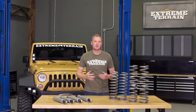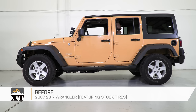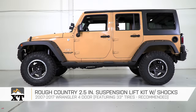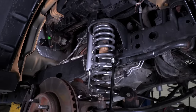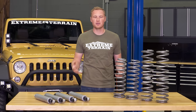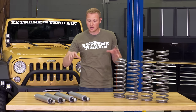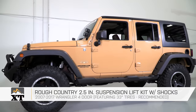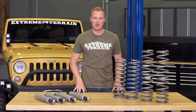If you're looking to run 33-inch tires and you'd like 2.5 inches of lift, I'd recommend taking a look at this Rough Country 2.5-inch lift kit with shocks for an economical solution. This kit includes your taller coil springs, your shocks, and also some brake line extension brackets, but not a lot of the other bells and whistles that can drive up the cost. So this is gonna be a little bit less expensive and make a really nice base to work off of that you can build on over time.